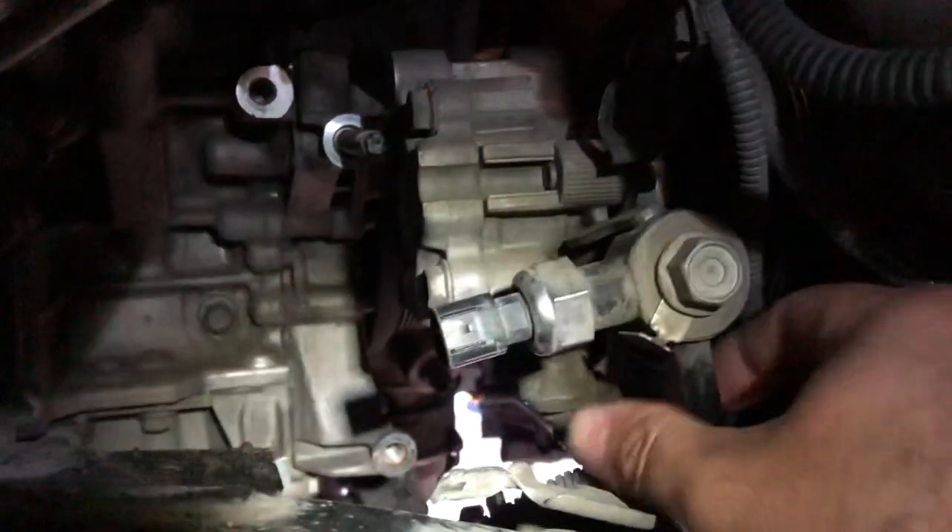Looking in from the side with a flashlight — there's a little rubber flap held by push pins. You pull the center of the pin back and then pop it out with a big flathead screwdriver; they're reusable if they come out decently. Your power steering pump is right there. A good light is really necessary for this job — I switched to a headlamp hands-free, which is much better. Here's the power steering pump; let's remove it.